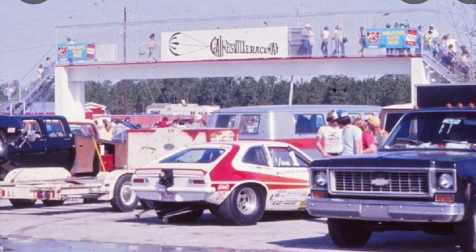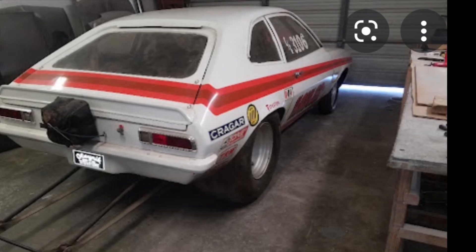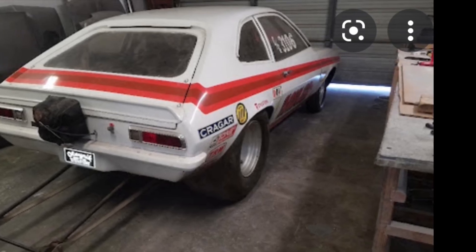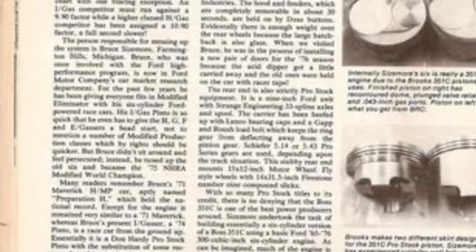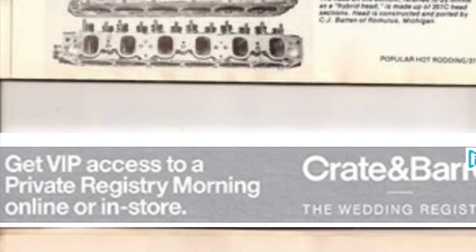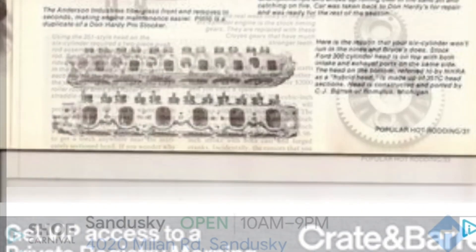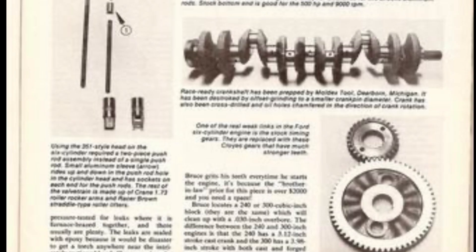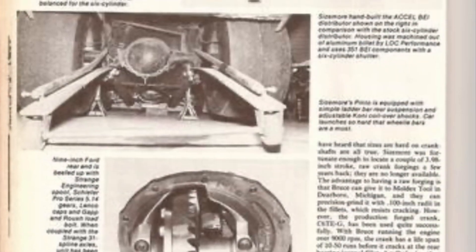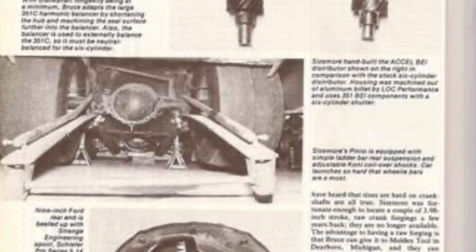Now he's back at the pits — look at that. That's a beautiful-looking picture: the wheel tubs, the chute. I like that old Chevy truck. Here's what it was like when it was found — still looks great. Amazing piece of history. Here's the article I found in Popular Hot Rodding — that's the 500-horsepower-plus Ford inline six with a Cleveland head. It uses Cleveland Pro Stock parts. Amazing. Although those heads don't appear to be filled nor the exhaust ports raised. I saw that same pushrod setup in Ken Ellison's video with the Ford 300 taken apart with a Cleveland head. Lots of history here. Hopefully you can read these — stop the image, read the picture. If not, you can find this article pretty easily on the net.